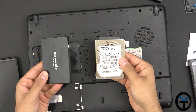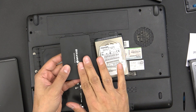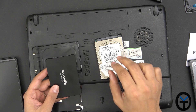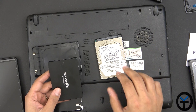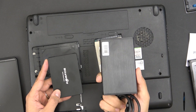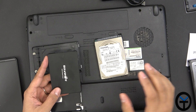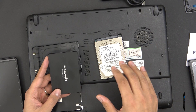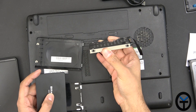We're going to go from this spinning 160GB, 5,400 RPM Toshiba hard drive to the Blitzwolf SSD. The way I did this is I installed Acronis disk imaging software — you can use any open source or free licensed software. I used the imaging clone hard drive option to clone this hard drive, connecting the SSD via a USB 3.0 external enclosure. It did take about two to three hours to complete since this system doesn't even have USB 3.0. Once done, you replace the hard drive and boot up to get the performance bump.